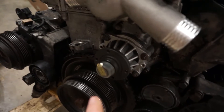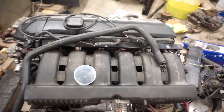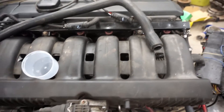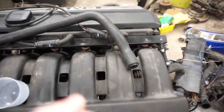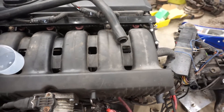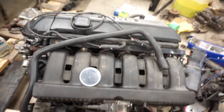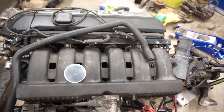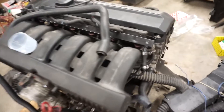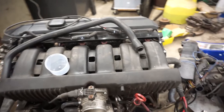I bought an aluminum water pump pulley that does not fit, so I will detail that later. To recap real quick: I rebuilt all the fuel injectors — by that I mean I replaced their integrated filters, the O-rings, and the little pintle caps. You can see the fuel rail on this is now different; this is an M50 TU rail, so it's got the lines that go underneath the intake, and I did get them routed so they'll work.